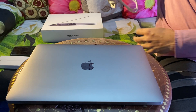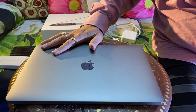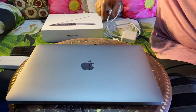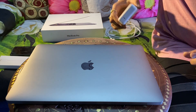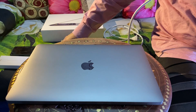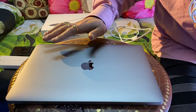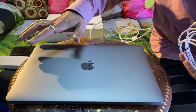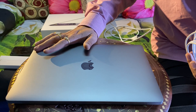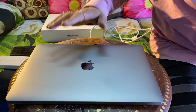After the connection, when I started using the MacBook Pro, I did not feel any tingling effect — no current leakage at all. So, first things first: the problem of leakage was because there was no earthing. Leakage current was passing through the output charging cable to the MacBook Pro, and there was no proper earthing.